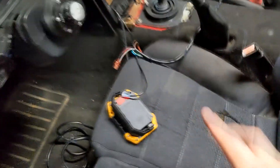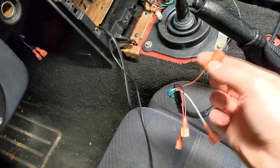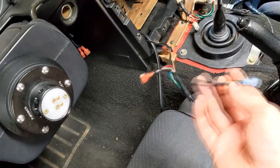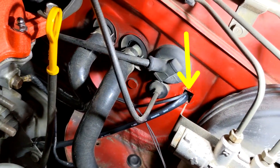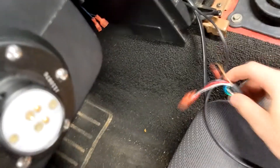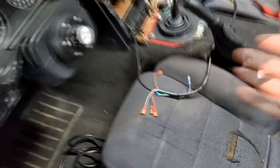For the brown, you need to make a whole custom cable. I have a male spade connector on the end of the brown, and then I have this very long cable with a female connection on one end. It runs down — I don't feel like taking it out because it's already zip tied under the steering column — but it runs through there, out a hole in the firewall. It's this upper wire right here and it runs around and is grounded right underneath the fuel pressure regulator. That ground runs through the firewall, and that's what you connect up to your brown on the Medusa plug. That's all four wires taken care of.